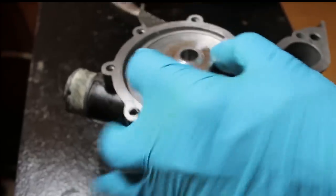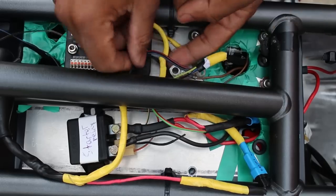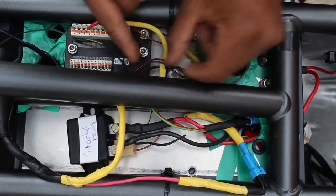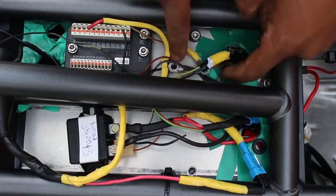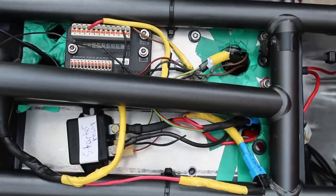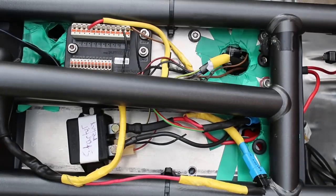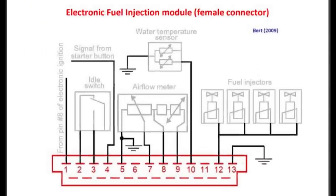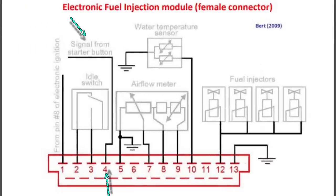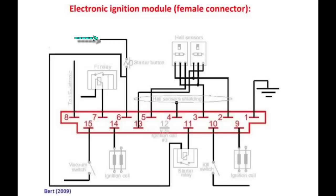You really want your air, fuel, and ignition system to be up to spec, because your ignition system is pretty archaic. People tell me to get a tune or a computer, but this is really really Flintstones fuel injection — you can't really do any of that unless you just swap it, especially Jetronic. The system is resistance-based, so it'll just listen to whatever input it's getting from things like the airflow meter, throttle sensor, temperature sensor, and hall sensor. If your temp sensor is bad, for example, it'll just tell the brain that the bike is cold all the time.